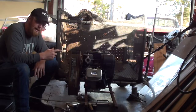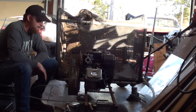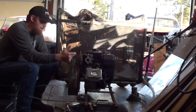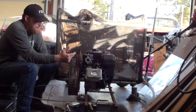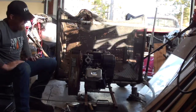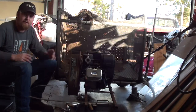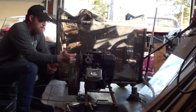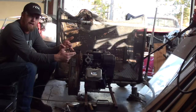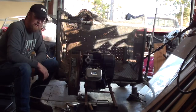I'm going to get her filled up with oil, filled up with gas, get her outside, and get her hooked up to the mower — I've got to get the hose back on here. Before I do that, I want to get a bolt in here so the discharge piece can be notched and held down with a bolt, because it does tend to walk up and blow off. With this engine having more power and running at full RPM all the time without bogging down, I'm going to have issues blowing the discharge piece off. I'll run a small carriage bolt through from the inside and tighten it with a nut and washer on the outside, slotted so I can slide it up and off. If I have to, I'll weld it on the inside just to hold it in place.